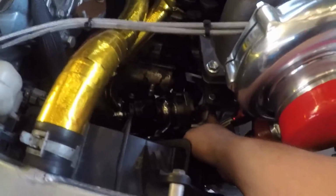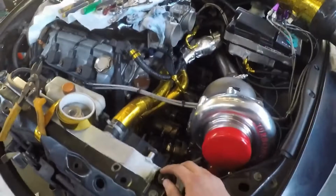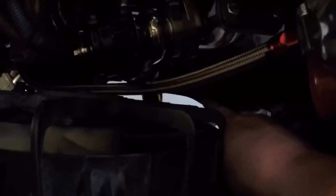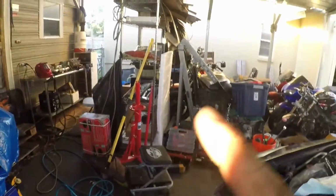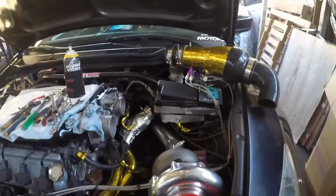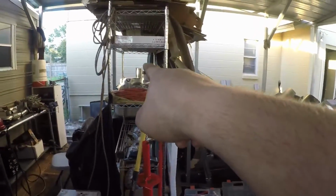So this up pipe, the turbo up pipe, needs to get wrapped, but for this I don't even have the right size. I think it's a 2-inch. I need to get a 2-inch to shoot my wastegate down to the ground, or it's gonna be burning through radiator hoses. So that's basically it. Once I got the downpipe welded, everything's coming off. It's all getting wrapped, and that will be tomorrow. And then I'm gonna start on the oil. I'm gonna start on the oil feed, the oil return.